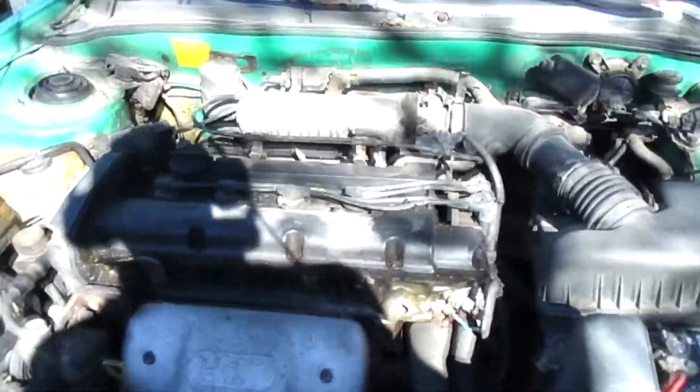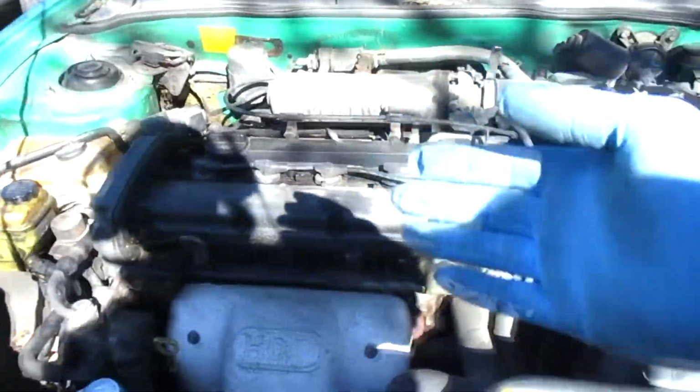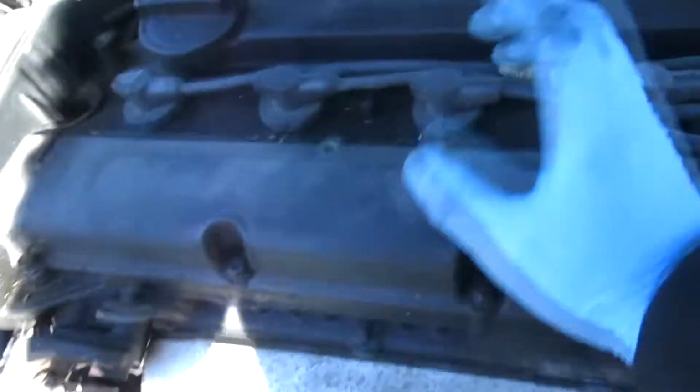All right, so as you can see, the axle's leaking a lot. Maybe the seal that's in there is busted a bit, or just the axle itself is loose. And the boot itself on the far right side, which I already jacked the car up and looked at, the boot itself already has a split in it, so that is probably why it's pulling one way and also not running as good as it should be because of the compression. You can even see it leaking out from where the spark plugs go. It's real wet in this area.